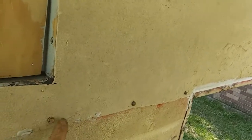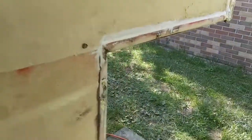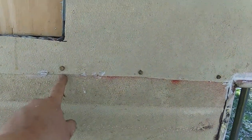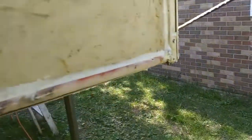This siding material is stuff used in restaurant kitchens and public bathrooms — it's not actual trailer siding. The original siding on this camper, from pictures I've seen, was fiberglass corrugated RV siding like you see on some Class A motorhomes. It's not aluminum and it cracks easily, so I imagine it cracked — maybe in an accident — and they fixed it with this material. I used screws from my old sliding camper to go ahead and do this. I need to find some edging to go around here and redo this front panel. This is the not-quite-finished product.